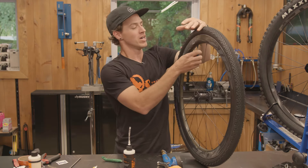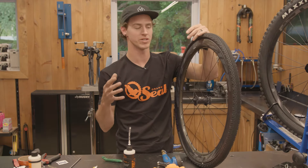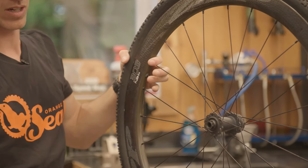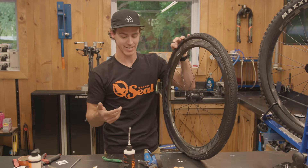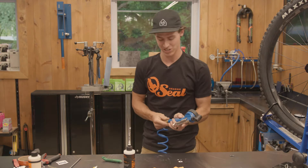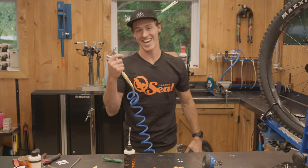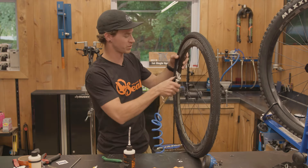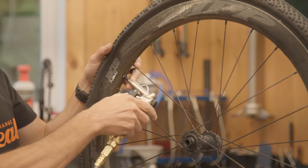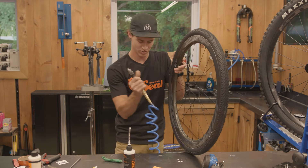Now we're back in real time. Let's say you're having a difficult time popping that tire up onto the bead of the rim. Remove the valve core — that's going to allow you to force more air in all at once. If that doesn't work, one of my favorite tools in the shop is just a good old-fashioned air gun. There's zero restriction in this, and it's going to have the highest flow rate of pretty much any tool you can put on a compressor. Hook it right up to the end with a needle point that fits nicely into the valve, and hold on to the tire because it's going to go quick.